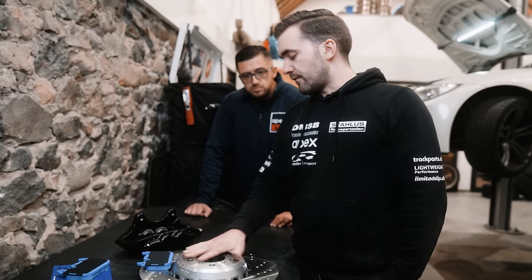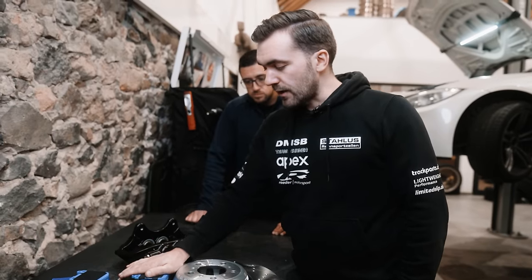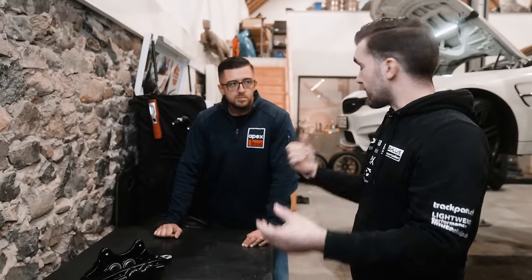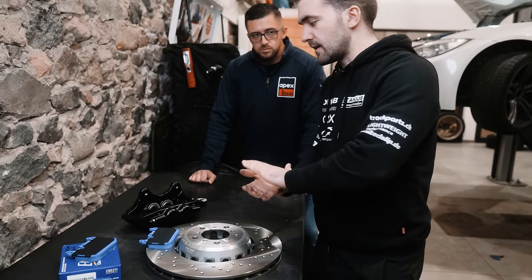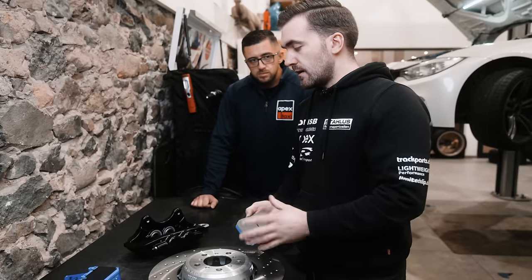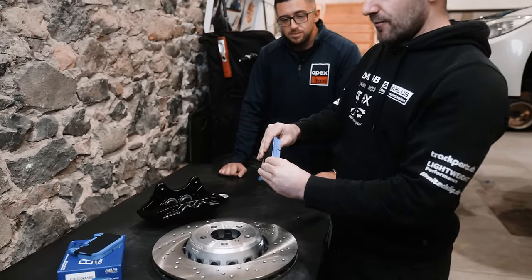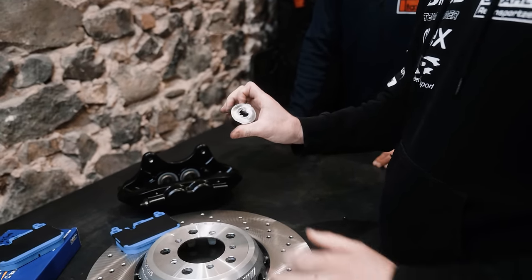Another thing worth mentioning is driving with assists on. A lot of people drive with assists on, which means you've constantly got brake pressure on corners where wheels are slipping. For instance, front left on a BMW — someone's pushing the car into a corner and leaning on the MDM. The front left brake is constantly grabbing the disc to slow that wheel down and stop you from understeering off track. This obviously generates more heat and wears more pad. In instances where the pad is completely finished on track, you'll wear through the material at an angle, and then even wear through the back plate.